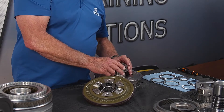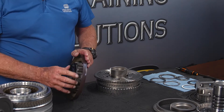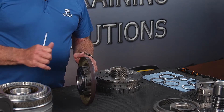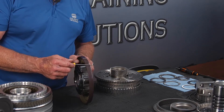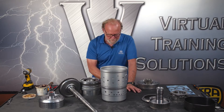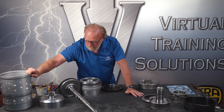Just like the rest of the planets, we want to make sure we've got no wobble on these gears — nice and smooth. Inspect for cracked or broken teeth; any of that happens, it's going to need a replacement planet. This planet also has a sensor ring with magnets underneath it — you can see it chattering as we go along. Those magnets touch off the intermediate speed sensor. The planet fits inside the housing and the sensor reads the magnetism through the aluminum, so that's how the speed sensor works.